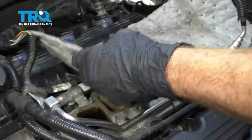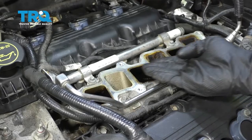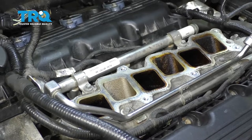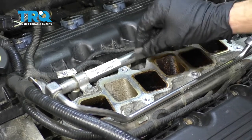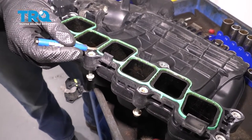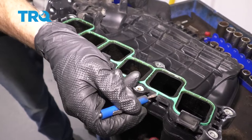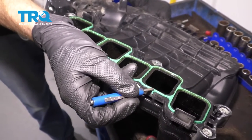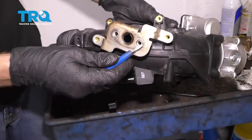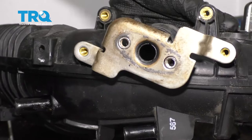Now carefully remove this — remember, it could potentially have dirt and debris on top and we don't want it to fall into the engine. After that, clean up this area, which is the mating surface where our intake is going to sit on top — make sure you get off all of this crud. Once the engine is cleaned up, think about the gasket that goes from your intake to the engine. It's a good idea to replace it. If you're not replacing it, at least remove it and inspect it — make sure it's not dry rotted and cracked, and that it's still soft and pliable. Also, over where your EGR valve rides, make sure that area is clean and free of debris. Sand it down, and then we can start putting it onto the car.